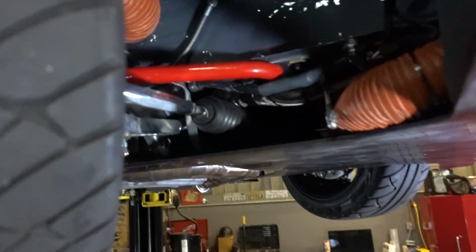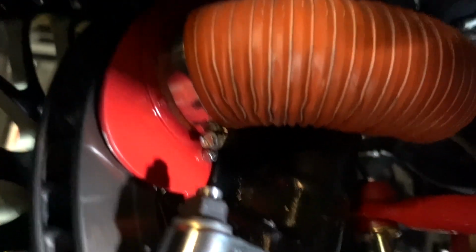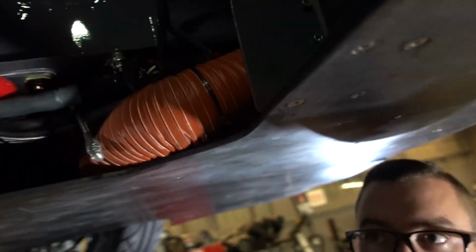Sweet. The ducting is actually, you know, I've just switched to these quick turn ratio Apex Engineering steering knuckles and the bump steer adjustable rods. And then this brake duct is actually a bolt-on piece that I started manufacturing that directs all the air from that front duct we looked at right to the inside of this rotor. So we're actually centrifugally pulling that cold air through.